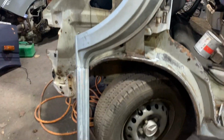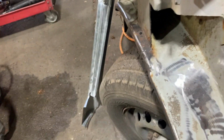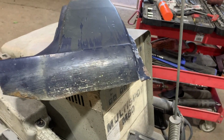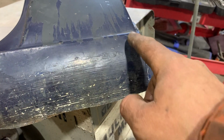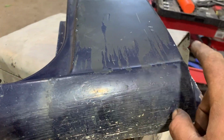I've welded that together. I've now got to adjust that end to make this section fit. Where's my top quality repair patch gone? So I'm going to cut that, I reckon, along the lip here somewhere. I'll probably joggle all this edge of it down through there, so joggle through there, joggle through there, so I can plonk the other one over the top of it, and then we'll just seam it in.